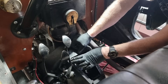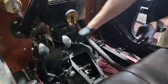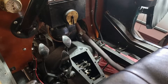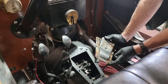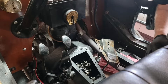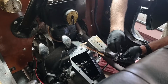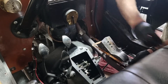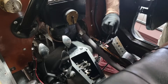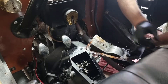I'm not going to paint the gasket - I'm going to paint the underside of the filter, just making sure those holes are all exposed. Hopefully you saw by virtue of that demo of the oil splash how vigorous the oiling system is - it's pretty decent, it slings it around. I prefer to paint the solid components rather than the gaskets themselves - it just seems to make more sense. You don't have gaskets sliding around, you can just hold this component and give it what it needs.